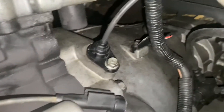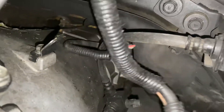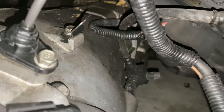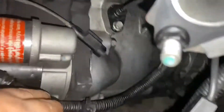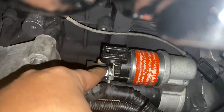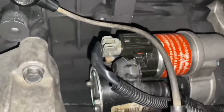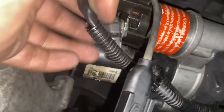Quick note: that sensor on the transmission bell housing is the crankshaft position sensor — if you ever need to replace it, that's the one. There's also a wire going back to the transmission — that's your reverse sensor to tell the car that your reverse lights are on. Then we have the starter, which is its own separate piece of harness. This is a 13 millimeter around that boot. I have the starter in now — top wire and bottom wire connected. That's a 13 millimeter.